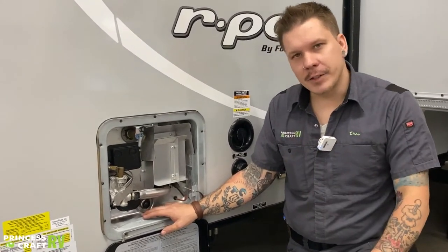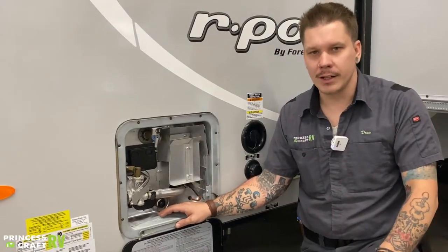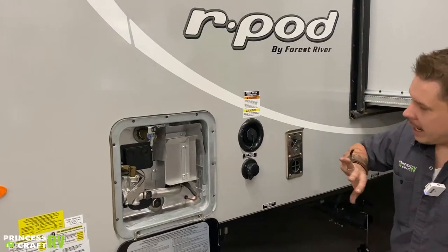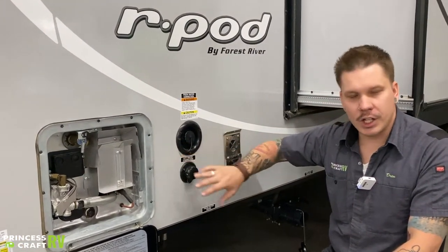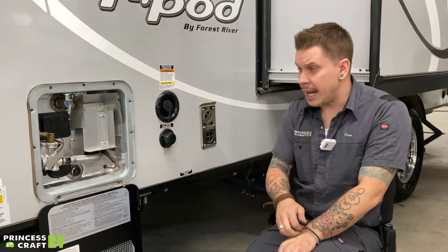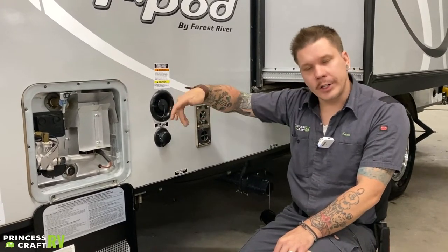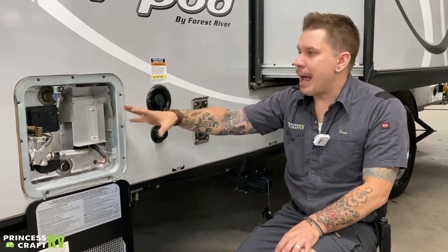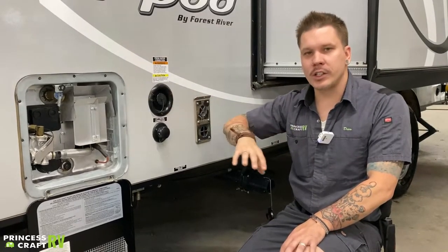The manufacturer also recommends replacing the water when returning the unit to service. That procedure is essentially the reverse of draining: introduce an inflow of water — city water connection, just turn on the valve; potable water, turn on the water pump. Once water is flowing to the inlet and the drain plug and anode rod have been replaced, use the hot side of any spigot or fixture and turn that hot side on. Initially, the flow will be very airy and spitty as it dispels air from the tank. Once that flow normalizes at your fixture, that is your indicator the water heater is ready for service — then you can apply power or allow the direct spark ignition to light the propane side.